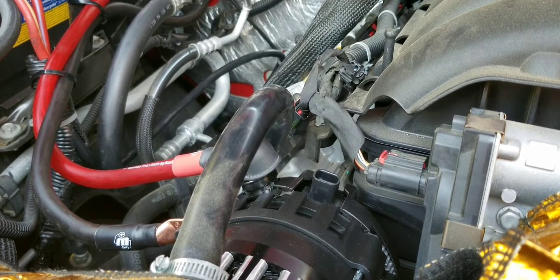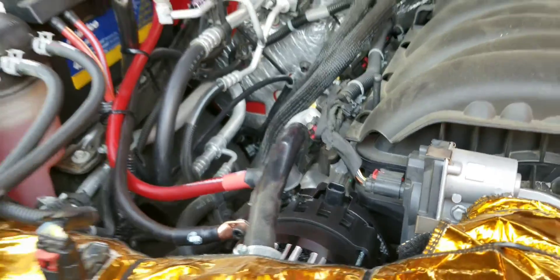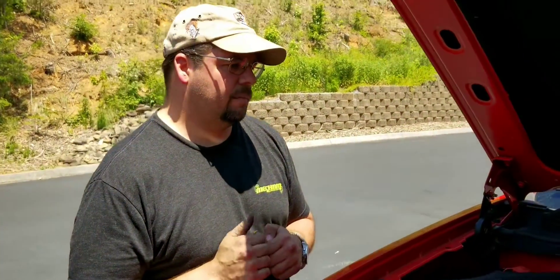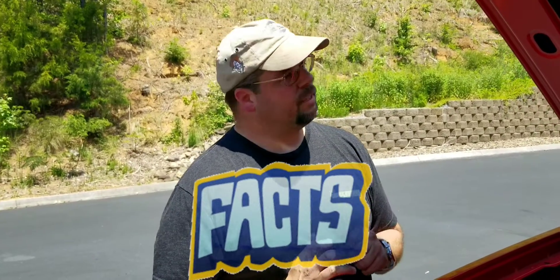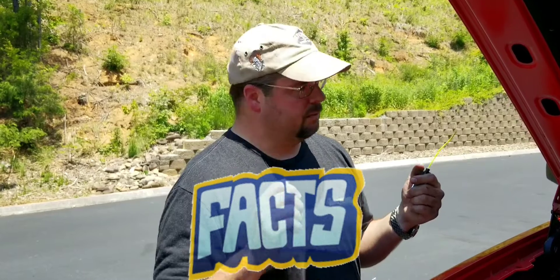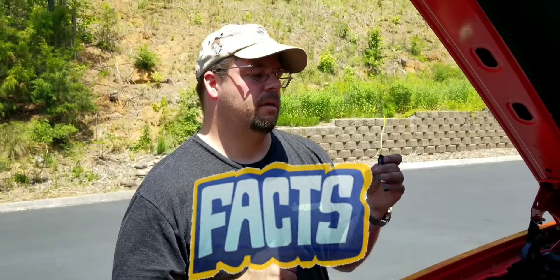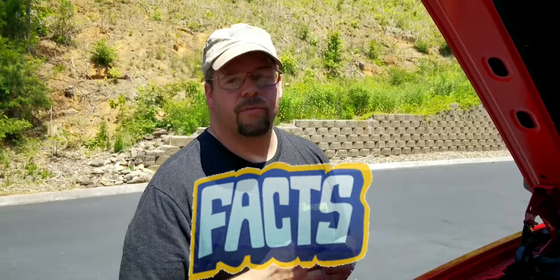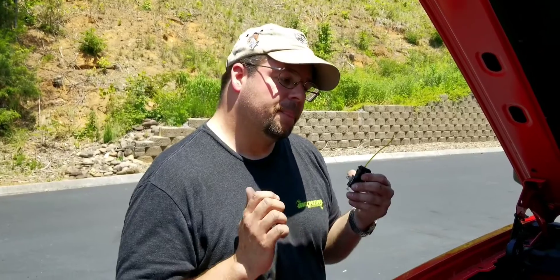With this, you'll get the old-school 1996 to 2004 behavior — 14.5 volts is kind of the resting point when it's warm. When it gets hotter, your Arizona and California people, if it dips to 14.3 or 14.4 and it's 120 degrees outside, don't freak out. That's just how electronics work. Colder climates, generally when you start up in the morning you'll get your 15 volts, sometimes a couple higher, but your real-world resting point is going to be 14.5, 14.6, 14.7 — all vehicles are different, all temperatures are different. That's how electronics work, temperature-based.